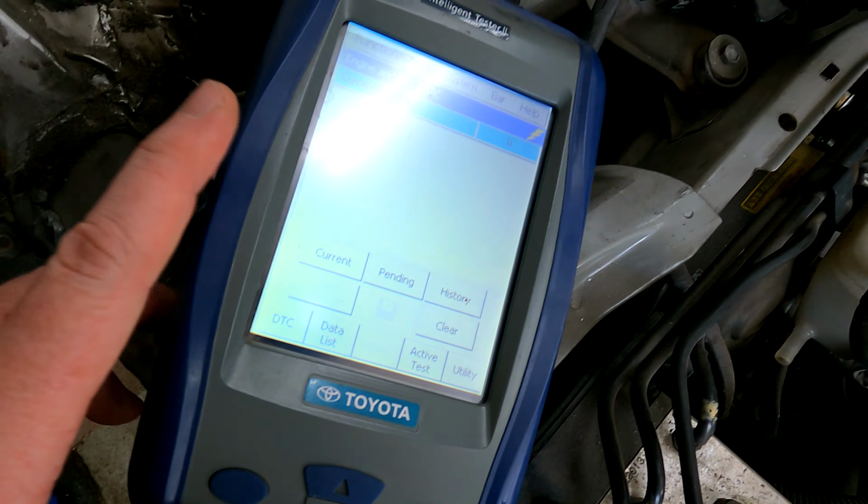While you're there, pull the battery out, take the tray out, and make sure that earth is absolutely fine. What I normally do as well is I use this little earthing point here, which the 1G used to earth to. I'll take it down here and take it to the back of the cylinder head over here. So just to show you, you've got your earths for your harness coming on here. So you've got another 2 bolt holes, and in this case a single bolt hole there. So you can use one of these extra holes and just take that 1G power cable, earth cable. If you need to extend it, just extend it and take it up to there. That should be all the earthing that is required.